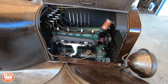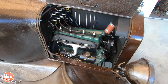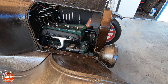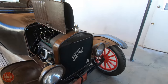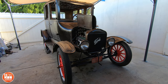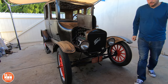Now I'm going to try to hand start it. I started it with the starter just now to let it warm up a little bit, because when I tried hand cranking it cold I wasn't familiar enough with how much I need to prime it and exactly where the throttle needs to be set to get it started cold. So it's slightly warm, but it'll still be interesting to see if it'll hand crank and how easily. I'll set the camera down here and we'll give this a shot. First, I'm going to make sure the timing is fully retarded and then advance the throttle a little bit.